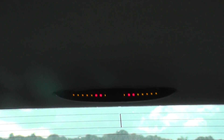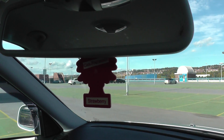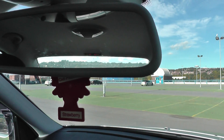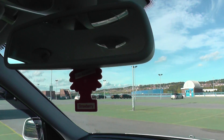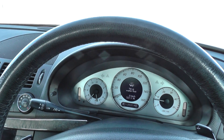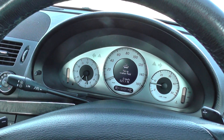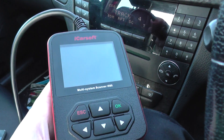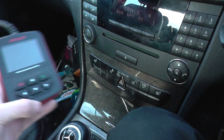Stop — don't go any further. So there you go, that is a short demonstration of the reversing sensors and the forward parking sensors. They call it the Parktronic. If you do have any trouble with this — sometimes if you put your car into reverse and all you get is the plain red lights, nothing else — then it looks like you have a fault with one of the sensors. You would generally need to use the iCarsoft i980 kit, which is available by clicking the link directly below this video. It will tell you which sensor is at fault. I hope this video helps. Thanks for watching.